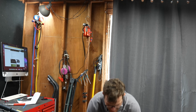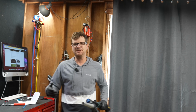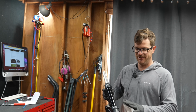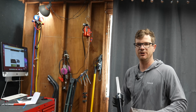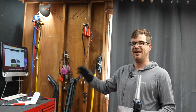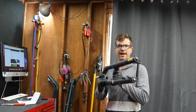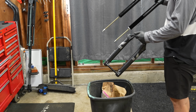So the previous Duralux I had was a completely clapped out one. I traded a bunch of nice Fox suspension for it just so I could make videos. I discovered it was actually a good thing it was a very clapped out used one, is they used a dry system in here, no lower leg fluid, and the bushings were absolutely torched. And I was like, it's making a noise. So it was the bushings being worn out. So reviewing an old clapped out product is actually pretty good for long-term reliability. So we're gonna see if this one is dry. Oh, we got lower leg fluid in there. So she's got a bath in there. That's a good thing. We're taking a look at the bushings and the foam O-rings in here. This is a super low mile fork.